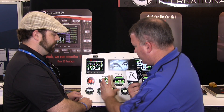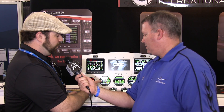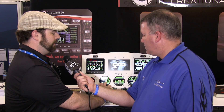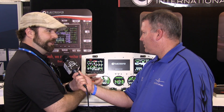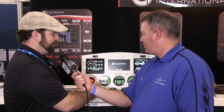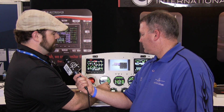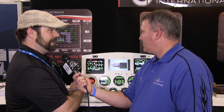So no space goes to waste on it. And what all can it do? There's so much information packed into that little spot. Well, on the first page you've got all your primaries and you've got tapes — your red lines and yellows. So it's going to alert you if you go into yellow on any of those six primaries. It does have the full bar graph with EGT and CHT. It will also do a normalized mode for EGT and CHT, where the bars should always be flat. If there's one rogue bar that's taller than the rest, then you know something has changed in your engine since the last time you normalized it.